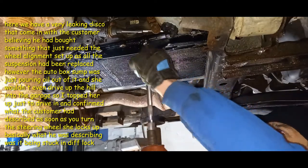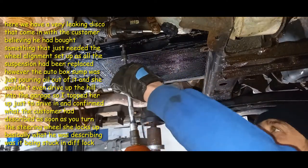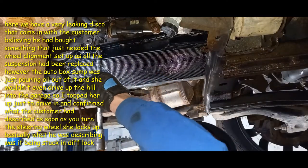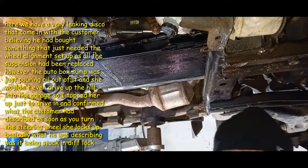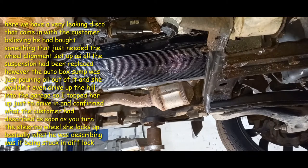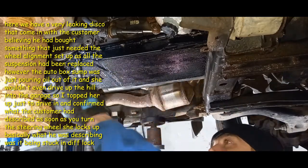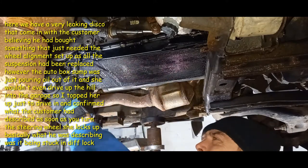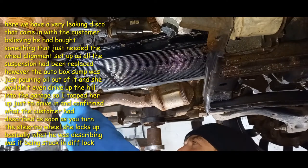So if you're lifting, you need to change this plastic one, you need to lift the engine up to get the filter out on them. So Britpart kindly do a new setup, because that's a bit dangerous. Britpart designed a new kit. You need to cut the filter, but the new one just goes in and the sump kind of holds it in place, so much better idea. So thanks to Britpart for that.